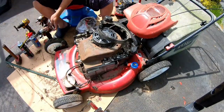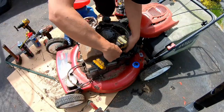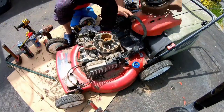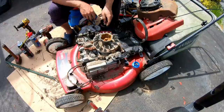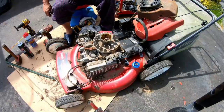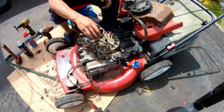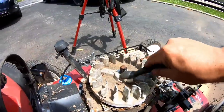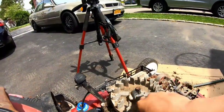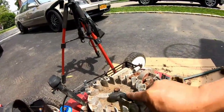Up here. Let's start — can I plug in here? Here we go. There we go. Just as I suspected. But when you guys have a funny feeling about the timing and stuff, and it wants to pull out of your hand, that's a sign of a sheared key.